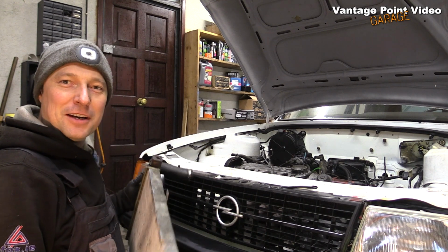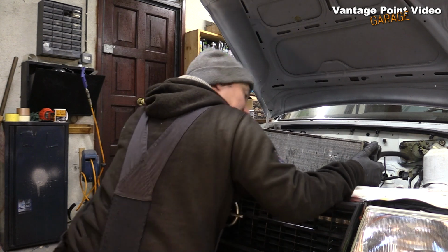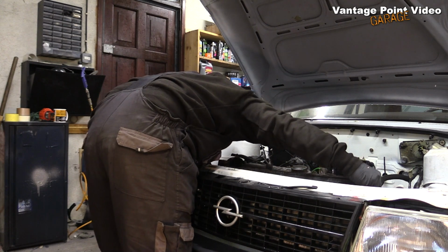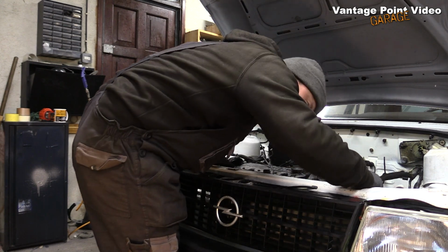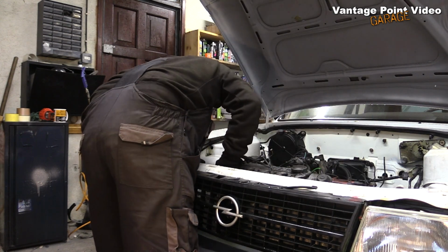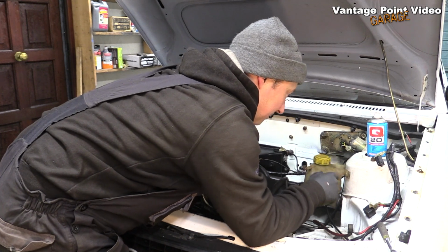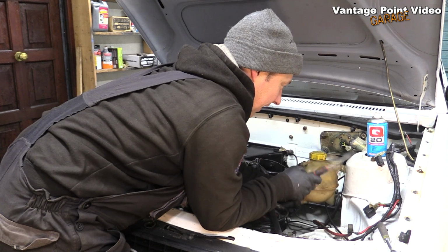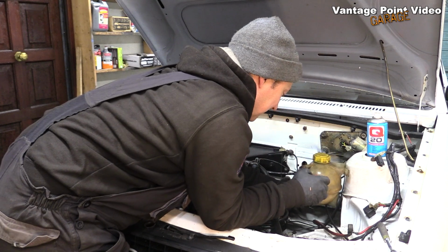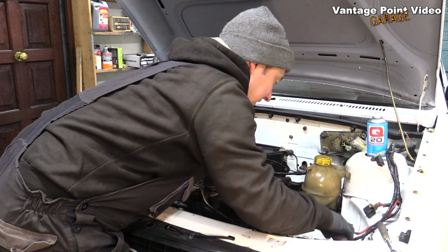If I'm going to get this car running, I'm going to have to keep it cool. So I'm going to have to fit a cooling system. This is the radiator that I got for Gina that time and said, I'm stripping that car down, ready for paint. So, gives me the chance to borrow a few bits like this. An odd thing there is that the spot welded on bracket for the header tank is missing from there, and a slot that it goes into. So I'd say this has had a fairly unconventional engine installation at some time in the past.